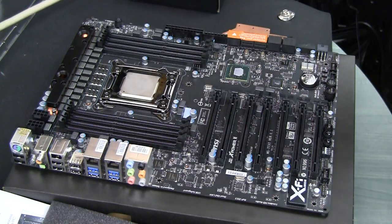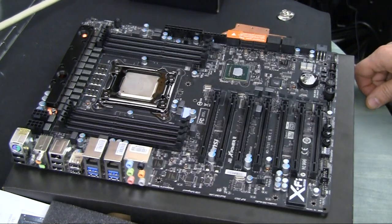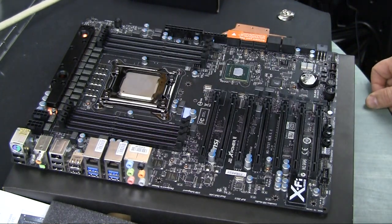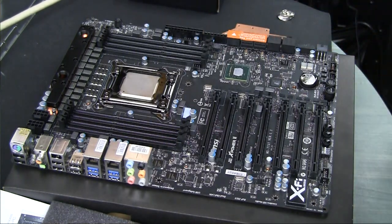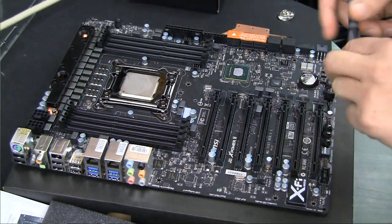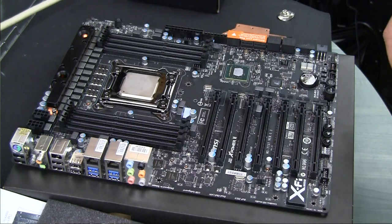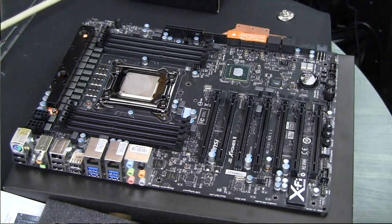Clean it again and put it quickly in place. I also want to replace this thermal pad because it seems it wasn't really properly squished. I'll probably put a 1.5mm version instead of the 1mm to give it a little bit more thickness, because that's definitely not enough.